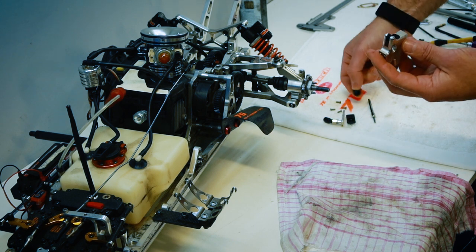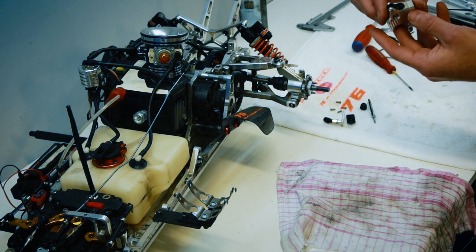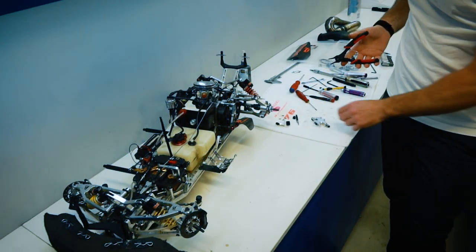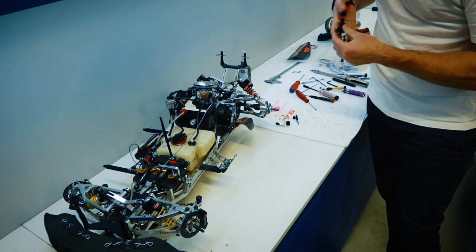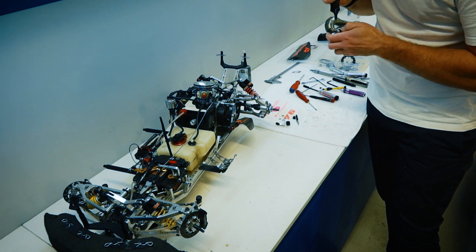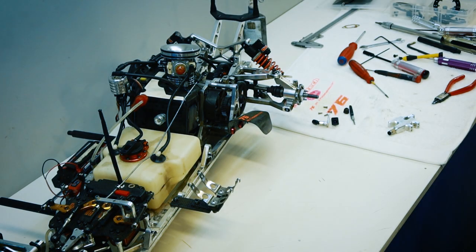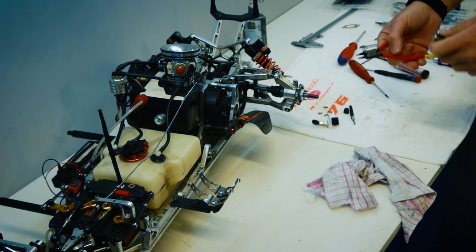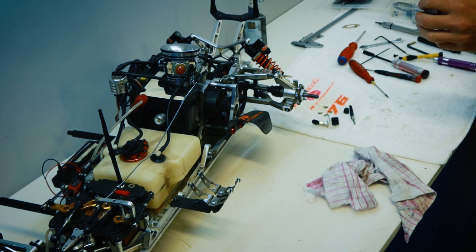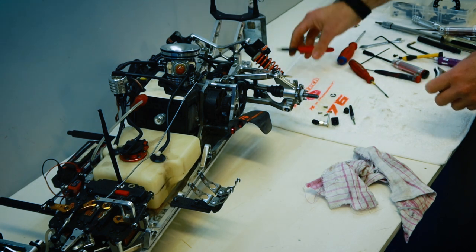Some dust seal. You can see the piston in there. It's held in with a circlip. So you need some circlip pliers to pull that out. All right, let's get this retaining clip out. I'll try, it's pretty tricky. It would help if we had a decent set of circlip pliers too. Well, I just had some trouble getting that out. I actually had to butcher my circlip pliers to get this out, but they're done now. They're called a Mecatech special tool now. Circlip out at last. What a nightmare.